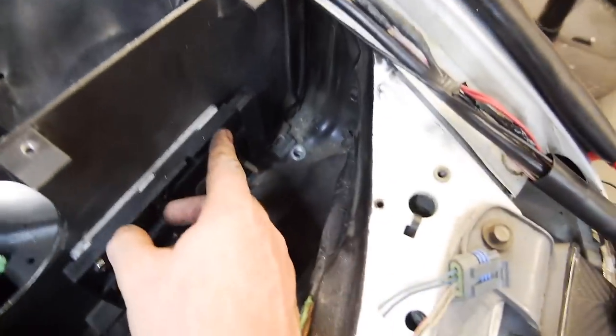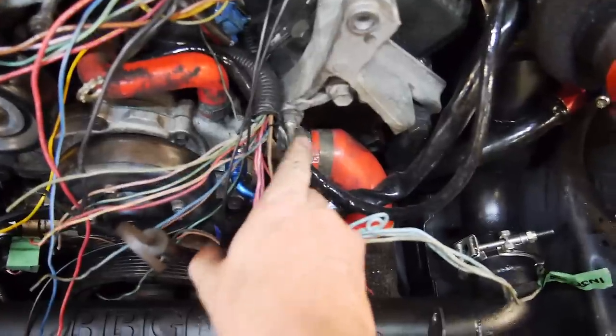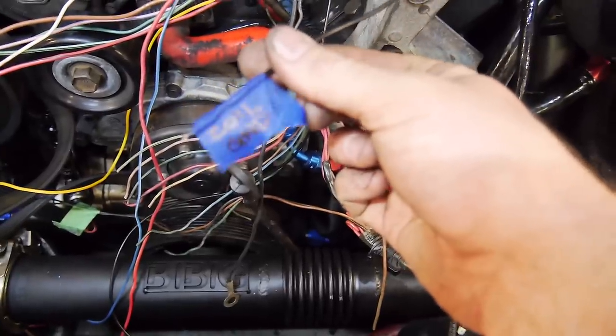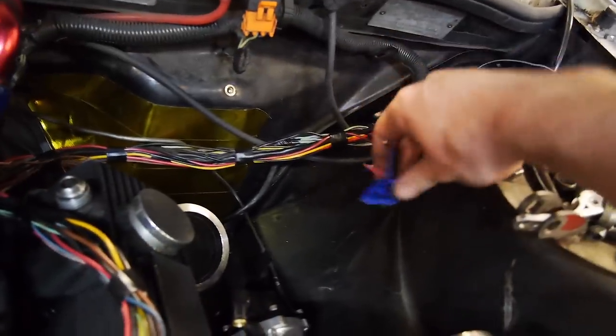What I'm going to do is basically have a ring terminal on there for the grounding stud. I've also added another ground for the coils' high-power side ground - that will ground under that stud as well. Then it comes out here in the loom where I'll have a separate, probably 2 or 4-pin Deutsch connector just for the power side of the coils.